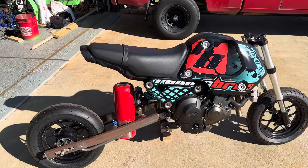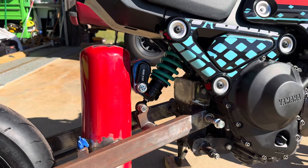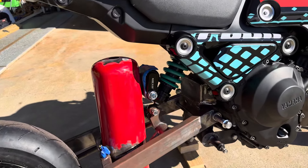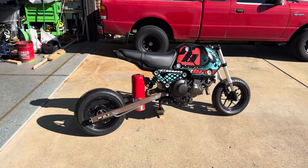They're doing the forks and this is their newer rear shock for the 2022 and up Grom. It's an unreleased spring rate — 175 instead of the 130, which is the highest you could go — and I think this is going to work out great.